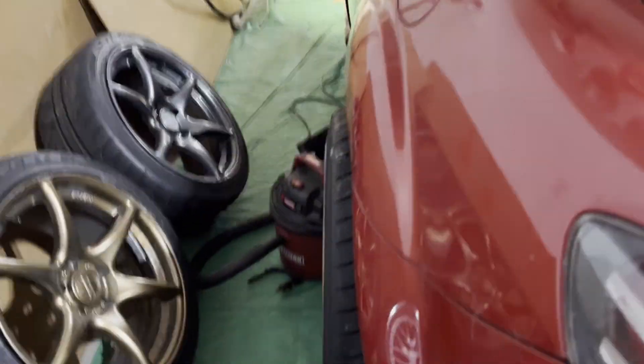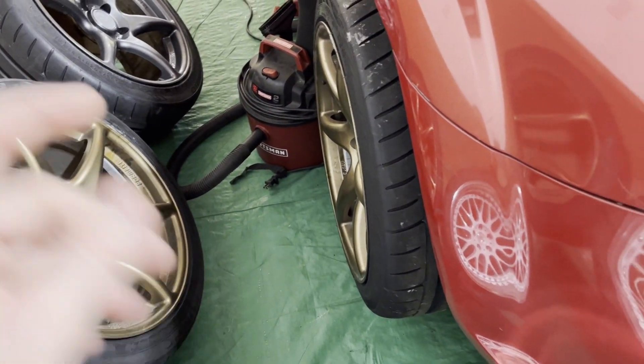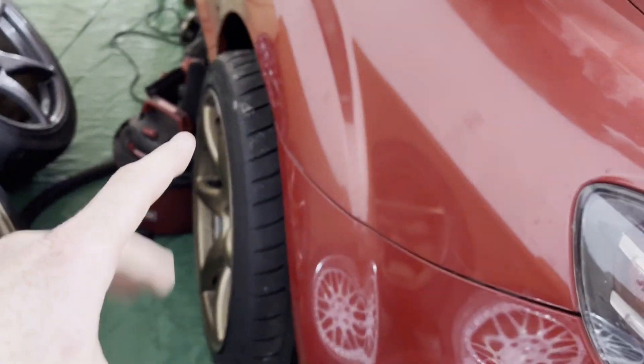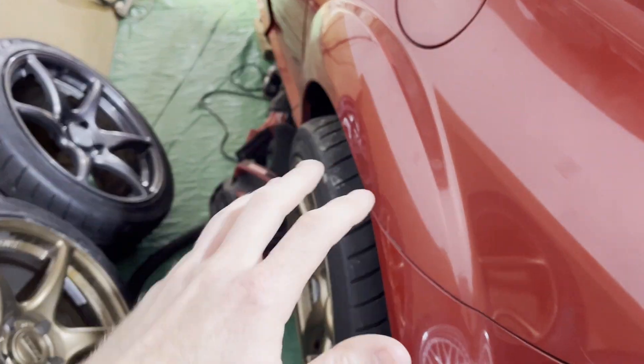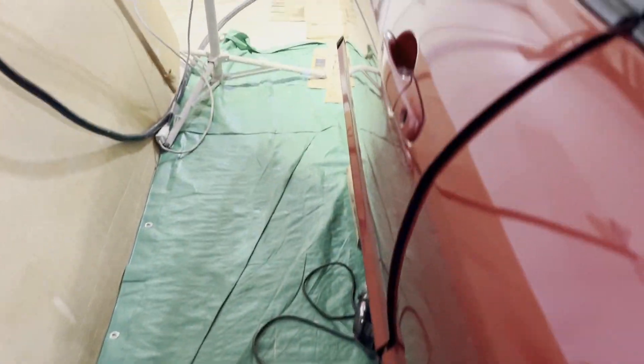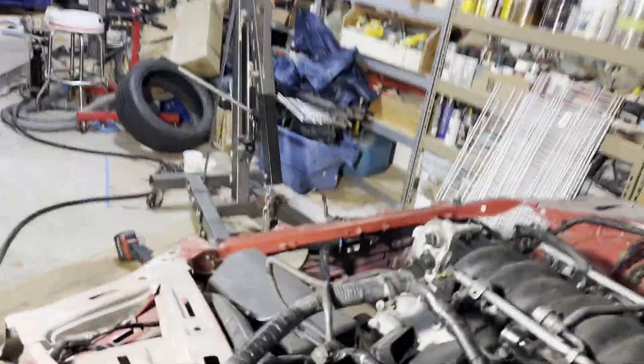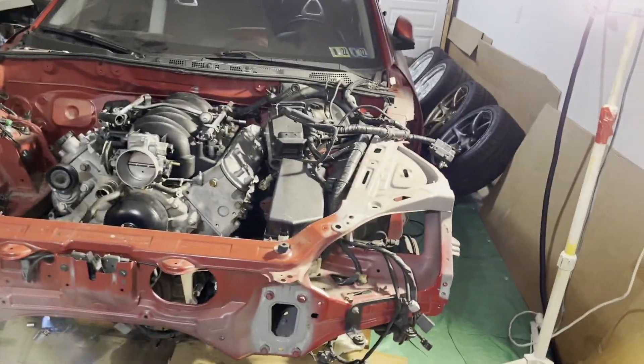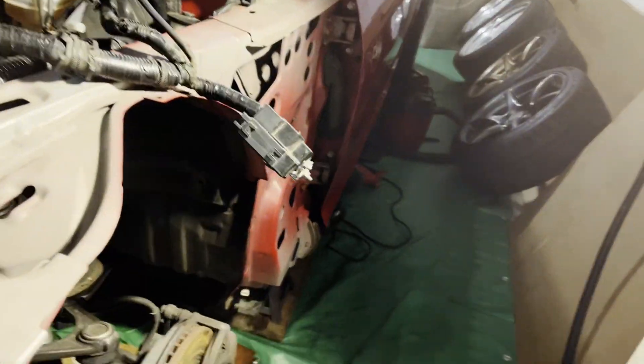Next up on this thing after I get the shifter done — I have a driveshaft on order, so that's on the way. The next thing I need to do is drop the whole rear subframe. The differential in this thing doesn't mount traditionally — there's actually a power plant frame, but now that I'm deleting that and I have my own transmission mount, I need to mount the differential and make some custom mounts. I also need to reinforce the rear subframe because they tend to just rip apart. So that'll be a whole project in itself.